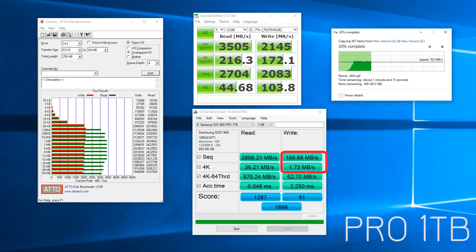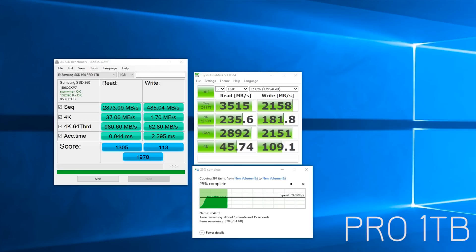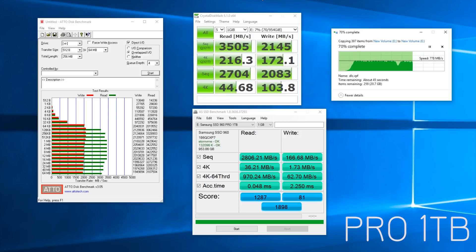I did have a few issues with the ASSSD testing, especially on the write speeds. The test currently shown includes ATTO, ASSSD, Crystal Disk Mark, and my real-world GTA 5 copy test, which is actually pretty impressive — it maxed out at just shy of a gigabyte per second, with an average of about 800MB per second. However, ASSSD on the writes was running at about 180MB per second. A previous test was somewhere around 500MB/s, but Crystal Disk Mark and ATTO were seeing well over 2GB per second on writes, so I'm not entirely sure what the problem is with that one.